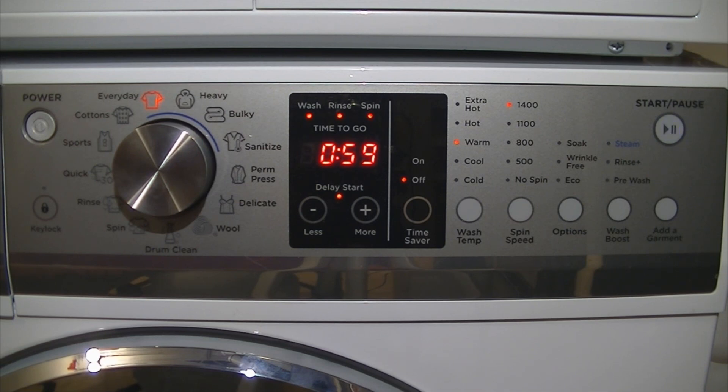The wash actions become a little bit faster and the pauses between tumbles are shorter or stop completely — it will reverse immediately. Wash temperature: as I said, this is the North American version covering the USA and Canada. As you may know, the USA is not metric yet, and Canada is fully metric, so Fisher & Paykel use temperature in degrees Celsius in other areas of the world, but releasing these in the USA especially — they've just named them cold, cool, warm, hot, and extra hot.